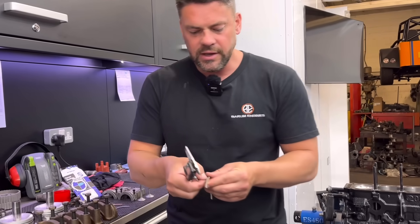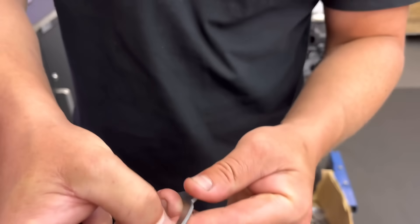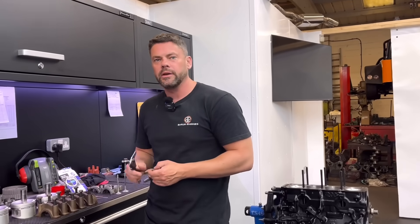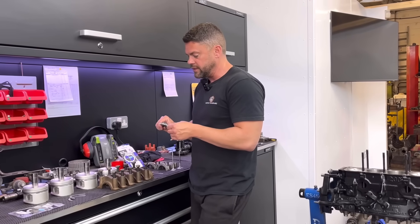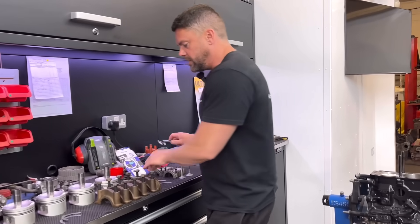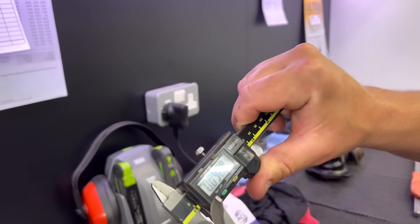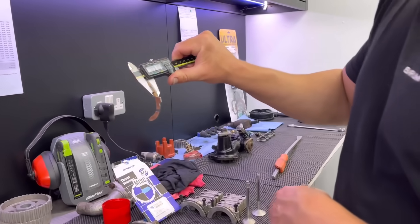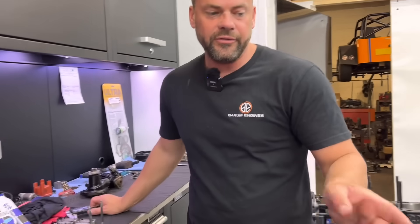On the backs. So if you see here — the thickness, you've got the coating which is very thin, and then you've got a steel backing. What we do is set that up on the surface grinder, just tickle the back till we get the right size — you can do it on the standards really. Measuring the standard thrusts — 92 thou thick, that's what they are. And these ones here — 97 thou. So it's 5 thou a side bigger. We want to close that up from 15 to 4.5 — 5 thou a side.